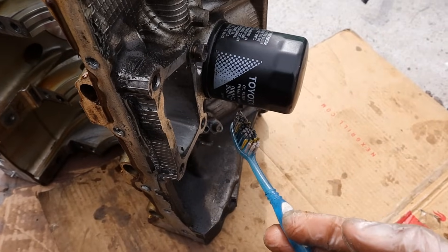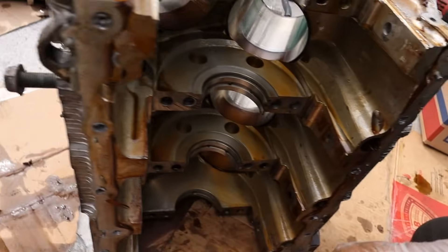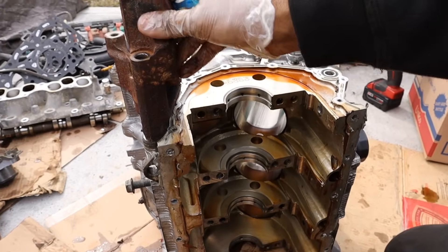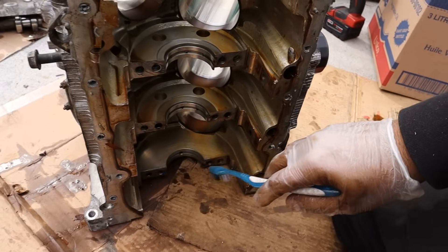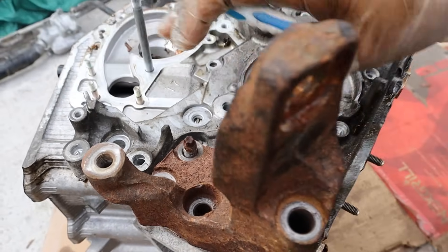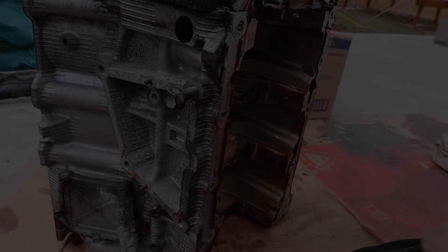Here's a fun fact: the 1MZ engine was originally cast in the 3rd and 4th generation Camry to have a front engine mount and a rear engine mount with four bolt holes. However, in the 5th generation Camry they switched to using side mounts, adding a bracket on the passenger side while the transmission handles the front mount and the driver-side mount. As a result, the timing belt tensioner bolts up a little differently, but everything else in the timing kit is the same. If you wanted to swap a 5th gen Camry engine into a 4th gen, you'd still reuse the same holes because the casting is identical.